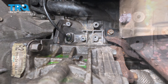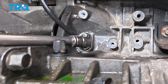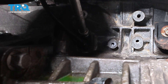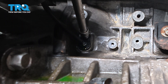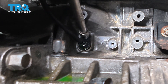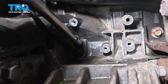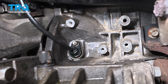Pull that out — right there is the crank sensor. I want to go ahead and get to that. What I'm using here is a shallow 10-millimeter socket with a 6-inch extension in my ratchet. Now the trick here is that this sensor is not straight on — it goes in at an angle, so that center almost goes down. It's not flush facing you. Once you break that free, that bolt itself just comes loose.